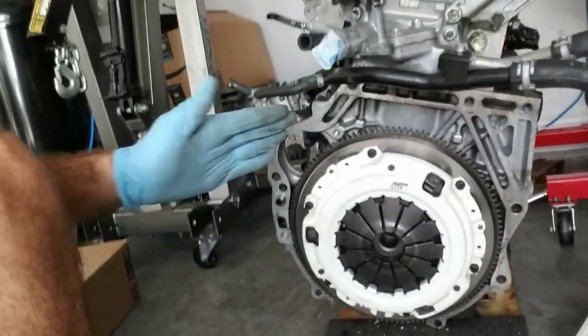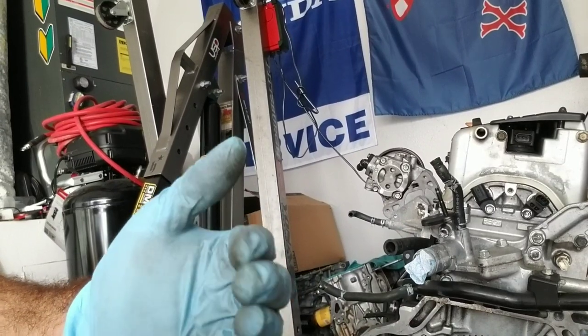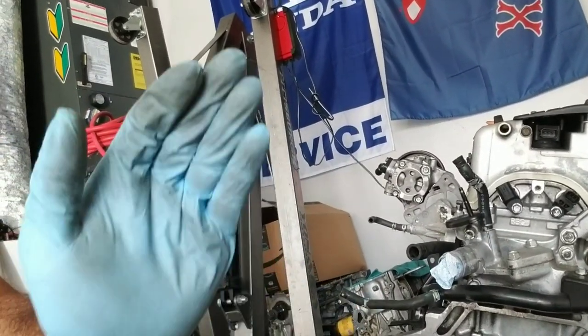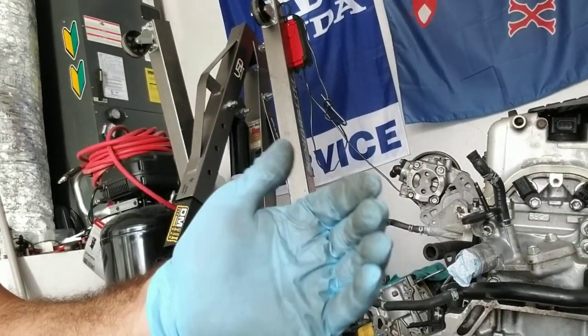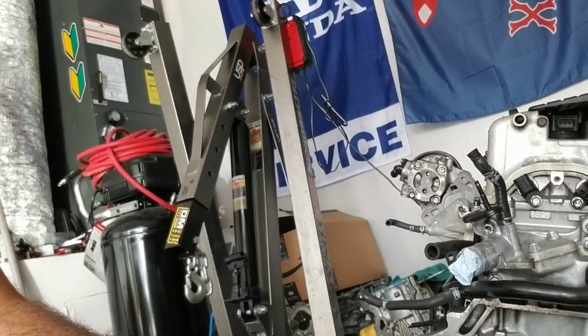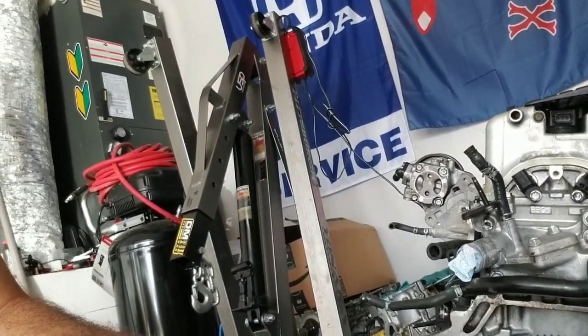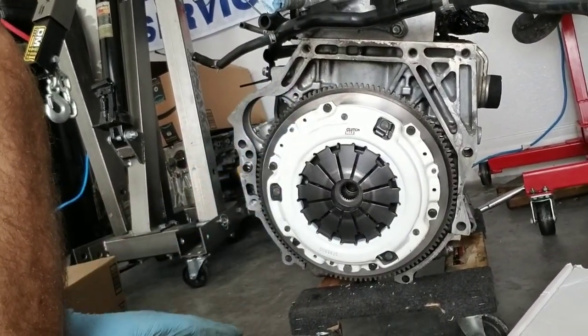Product. I didn't want to bore you with all the steps. I did take a while to figure out my torque wrench when I was going up. It was really delicate because it was 5 pounds, then 10, and then 14, and then 20. I might have rounded off to 20, maybe 21 or 22 overall when everything was said and done. But nonetheless, everything is torqued down to spec.